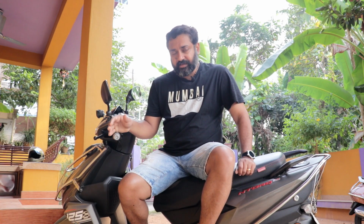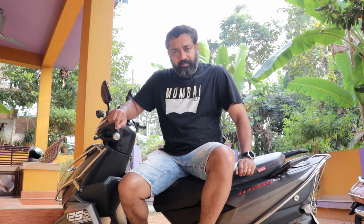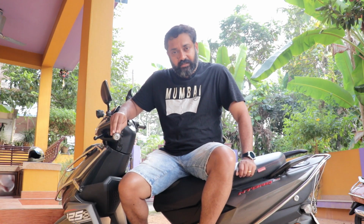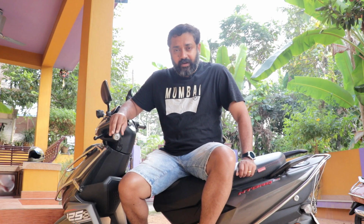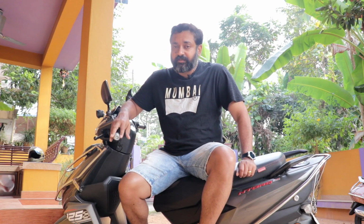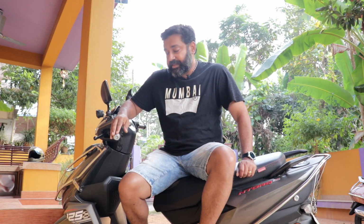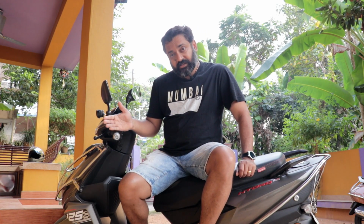A guy from TVS is always in the service center, and I got him. His name was Tamim, and he drove this vehicle and another TVS Ntorq, and he understood what I was telling him, that there is a problem in this vehicle. When there is a problem and the vehicle is under warranty, we expect the manufacturer to rectify it and give a cost-free replacement. I was always positive, because this had a warranty. It took a delay of around 14 days because they did not have the suspension. He told me he needed to change the front suspension and the cone and ball set. I said, is it required? He said, yes, it is required.